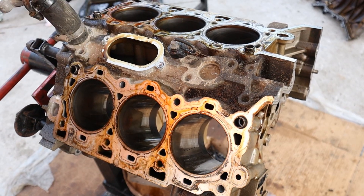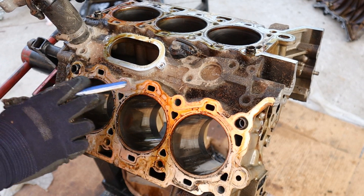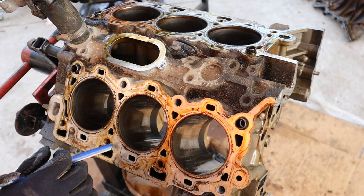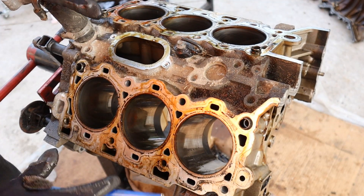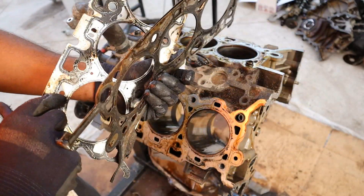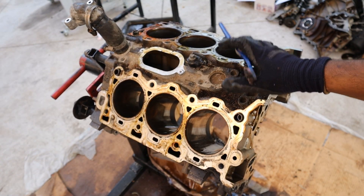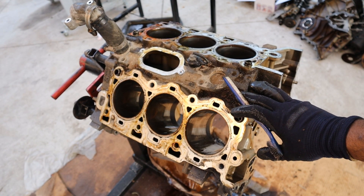Looking at the top of the block, we have this cavity which leads down to the sump — that's for the PCV system. Interestingly, the Duratec engine uses a semi-closed block design, which means the cylinder walls around here are not open to coolant — it's actually closed up in between, and that gives it a lot more strength. Overall this engine has a very simplistic design, which lends to its reliability. The head gaskets that came off are pretty crusty, but I'm not really seeing any obvious signs of failure — this is a multi-layer steel gasket.